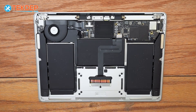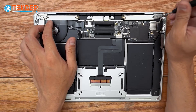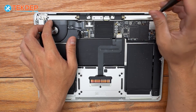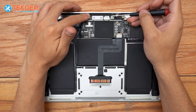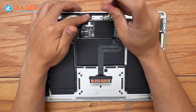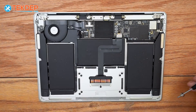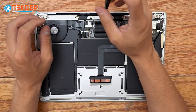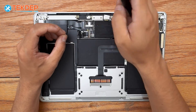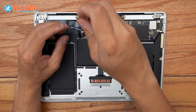We're going to start with a T5 screwdriver, removing the four black T5 screws that hold the Wi-Fi vent module to the top case. Then we're going to remove the two black screws on the inner LCD section. Next, we'll switch to a T3 screwdriver and start with the most important section — the retention bracket for the LCD display connector. Then we'll move on to the retention bracket for the Wi-Fi antenna cables.